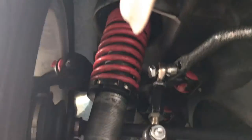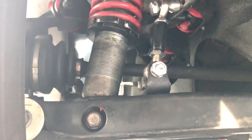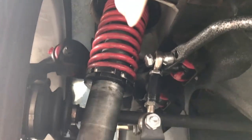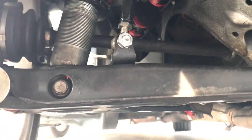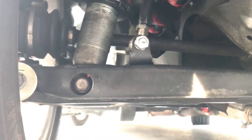And then of course the VMAX coilovers. I have these in the rear set to about 5 inches. The two lock nuts on the fronts are almost at the very top of their adjustment — that just cleared where I could not rub the front fenders. They recommend a 9½ inch ride height on the fronts; I actually ended up doing higher than that. The car is aligned now.